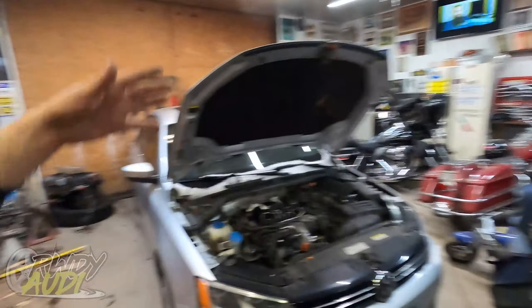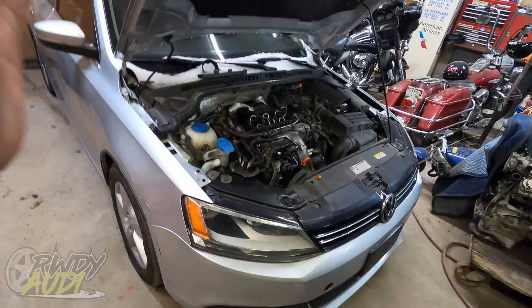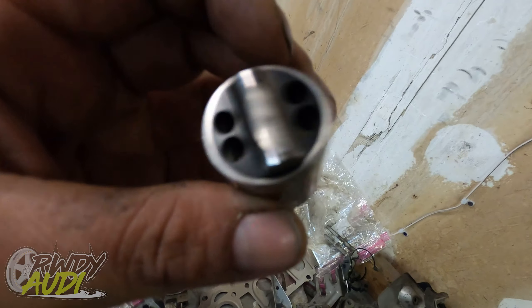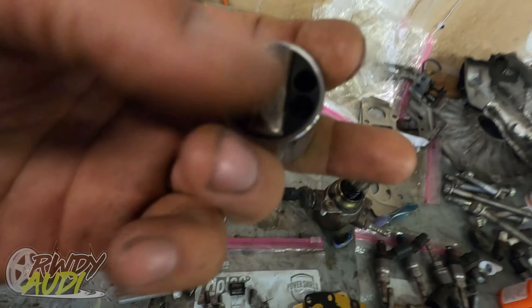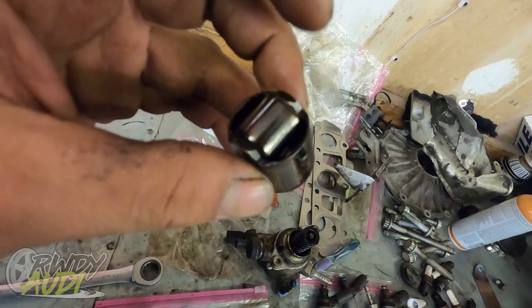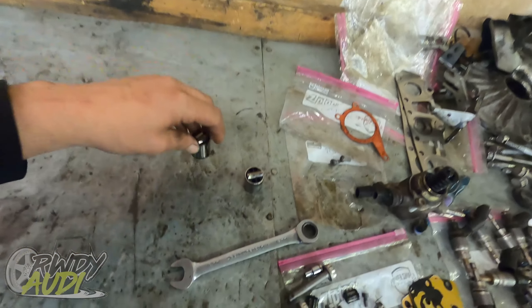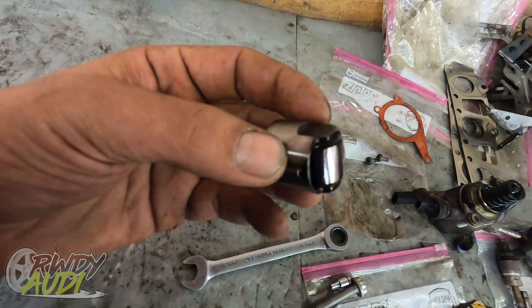For those of you who are new to the channel and don't know quite what's going on: this Volkswagen TDI has been through a hell storm. It's one of the TDIs that fell susceptible to the dreaded cam follower inside of the CP4 pump. What happens with the cam follower inside the CP4 pump — it likes to pick up and move and then drop back down, riding the wrong way on the cam follower. That's because this is a cam follower out of a gasoline powered engine, specifically that 3.2 over there.